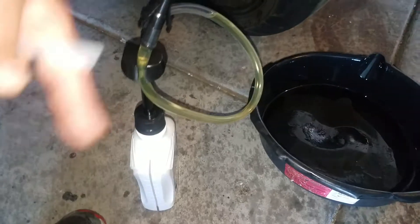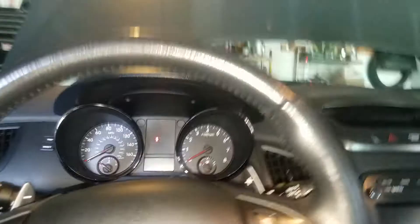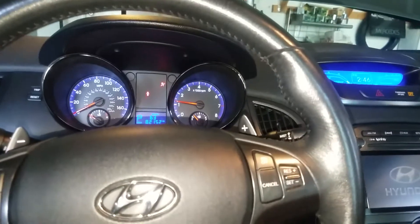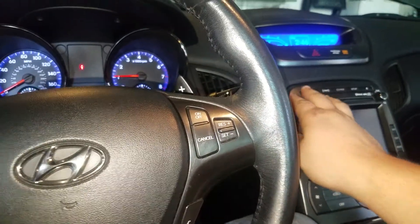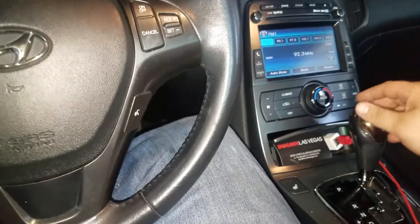It's a one-way pump — it'll pull straight out of the bottle and shoot it up through the hose into the inlet. So here's the first startup since I put in the new fluid, hopefully everything goes well. Whenever you do engine oil or transmission fluid, after you start the vehicle, the rule of thumb for transmission work is to give it about 10 seconds and work your way through each gear, once all the way down and once all the way back.